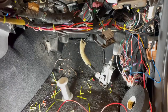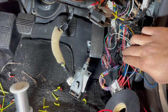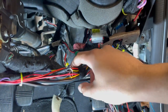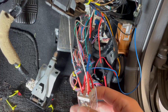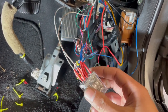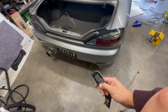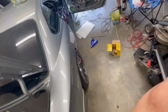It's very complicated looking at this right now, so it's going to be hard to explain what's going on, because we've done a whole lot of cleaning up from all the third-party aftermarket stuff. Essentially what I've done is routed all the cables, heat-shrinked everything, and also taped everything up. This is the main harness — I still need to tape some of this stuff up. If you want to get the indicators to work and flash both at the same time, you will need a relay — it's a little bit complicated and a pain to explain. But that's just to get your indicator lights to work when you press the remote. If I press this, you can see the indicator lights work and they both flash at the same time.